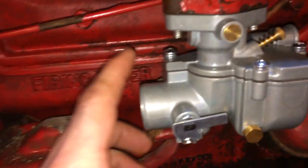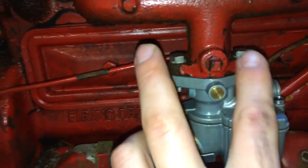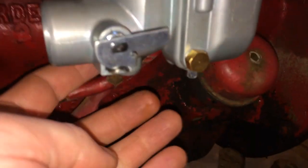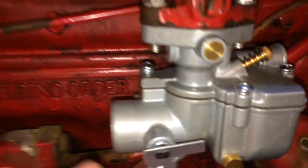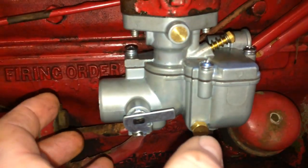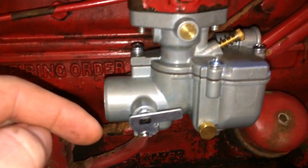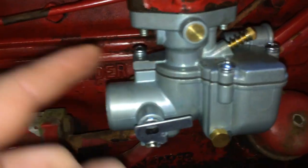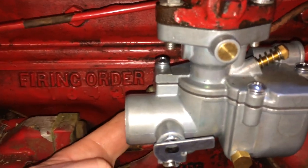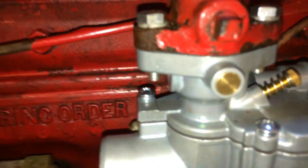I very delicately pulled the linkage rod out, disconnected the two bolts, made sure I didn't move the bracket, got the carburetor out where I could put a good torque on it and tightened that screw up. Then I put it back. Put your rods on before you bolt the carburetor on — you'll be able to twist the carburetor a little bit to get your cotter keys in. The choke cotter key is the hardest one. Then set the throttle linkage into the throttle mechanism and cotter pin it. Once those two linkage rods are attached, set the carburetor up there and bolt it on.